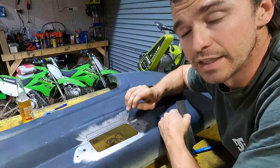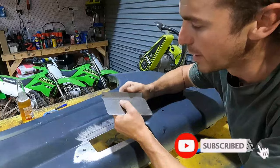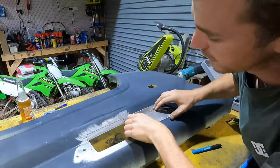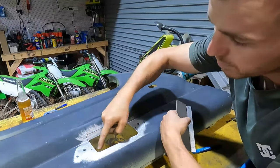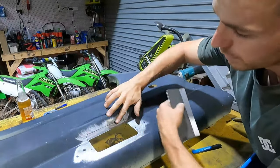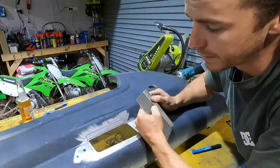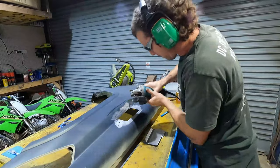to grind first and then to bog it and fill it nicely, make it all flat again, and even the sanding is just going to be a pain. Where I've already got this beautiful radius, so why damage it? Because it's a perfect fit. So what I'm going to do instead is extend this hole down a bit, and that'll line up with this edge, and then we can have our weld out here on the flat where we can access it easy to grind it down, put a bit of filler in it, get all that sorted. So yeah. Okay.